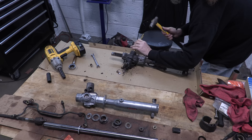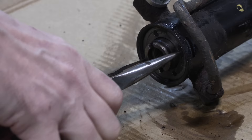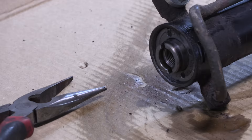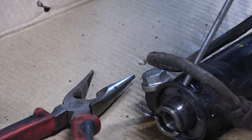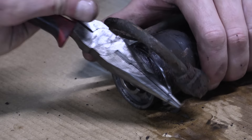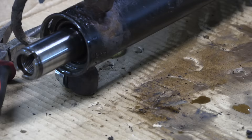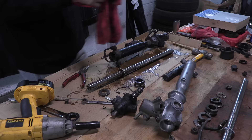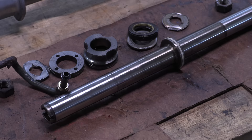Even though all the lines on Travis's rack look a little rusty, I think there's enough left for a nice long life. First, I want to show you an example of an uncooperative stopper. No matter how hard I tried, I could not turn the stopper clockwise — the wire rusted in place so hard against the outer housing it wouldn't budge. For whatever reason, I was able to get it to turn counterclockwise and bend the wire enough to grip it with pliers and pull it out. Don't cut the wire, or now you'll have two things stuck inside the groove. Do your best to keep the wire intact. You can just shove the whole steering shaft out of the cylinder side with everything stacked up on it like an assembly. This shaft is in spectacular shape compared to mine — there's some visible discoloration, but nothing you can feel with your fingernail. I call that a win.